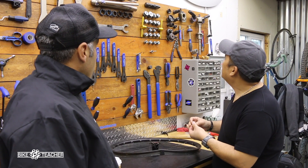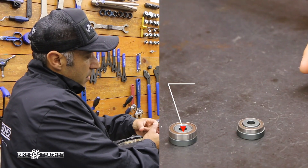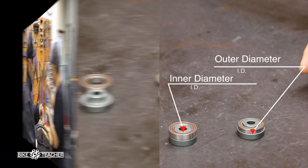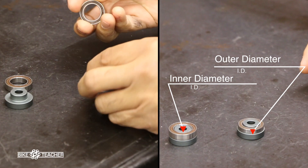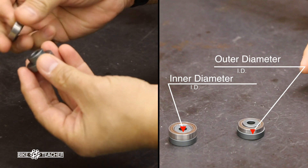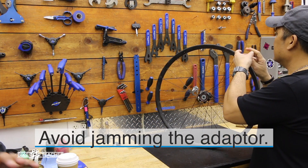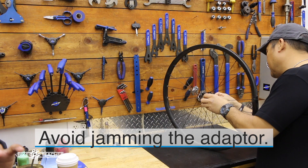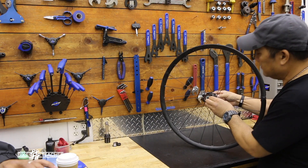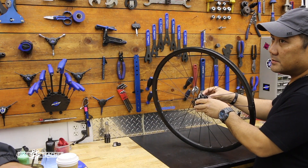Grab your kit and match up the adapters to fit as tight as you can into that bearing. Make sure the tool fits nice and snug in the middle and just on the outside edge, so when we press in that adapter doesn't get stuck inside the hub. You've got the inner diameter and the outer diameter — you don't want the outer diameter to be bigger than the bearing. You definitely don't want the adapters oversized larger than the bearing's outer diameter, because if you have to sink the bearing deep inside, that adapter would follow and get stuck. Keep it slightly smaller so you can take it out when done.